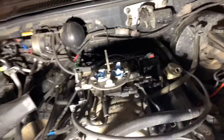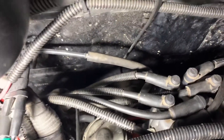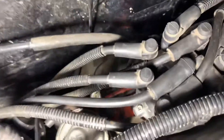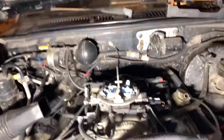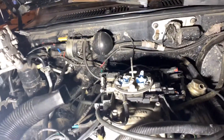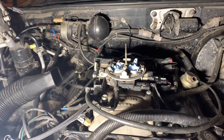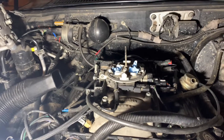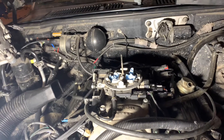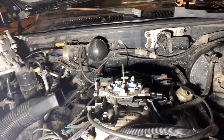The first thing you want to do is check the oil pressure sending unit, which is back behind the distributor, or to the left of the distributor. It's under the plug wires. You're going to want to take that off and use a mechanical oil pressure gauge or an oil pressure tester to test the actual oil pressure. On the 5.2 Magnums, it's supposed to be pretty low — a minimum of 5 PSI at idle for light duty trucks. If you've checked that and the sending unit is not the issue, then check the oil pump.